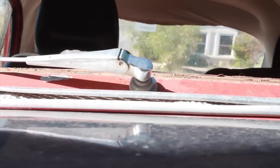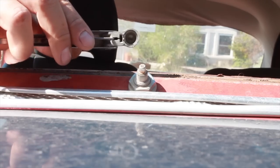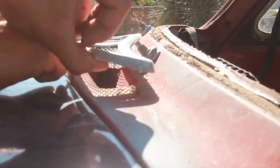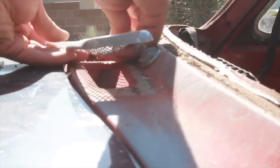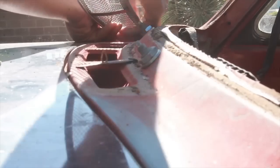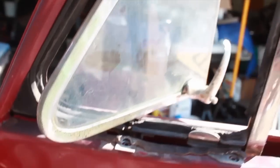Let's remove the wiper blades — flip them up and pull straight out. Once that's out, you can also work on the wiper cowl, which has about six or seven snapping clips that just hold it in place. Once it's out, if your mesh is dented or bent like mine is, just flatten it out. Note the size you'll need to remove those two nuts, and inside you've got four screws holding the whole wiper assembly in place.